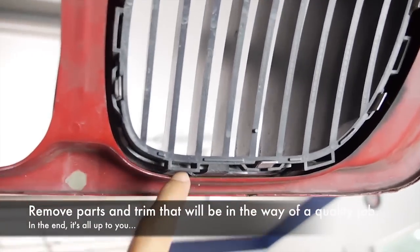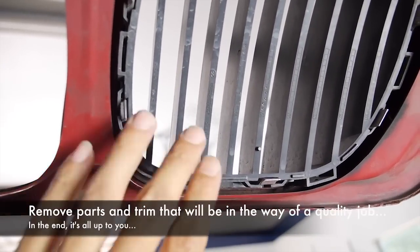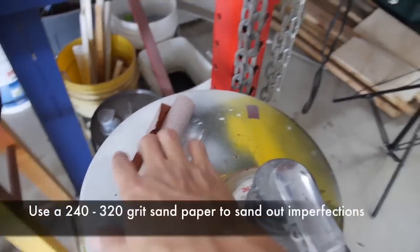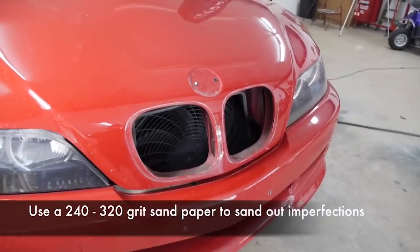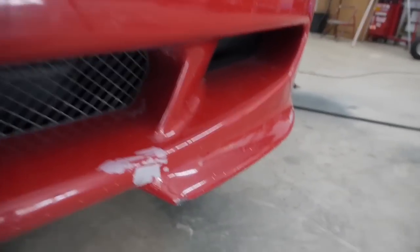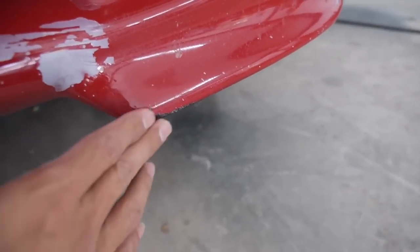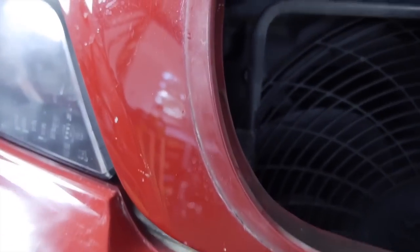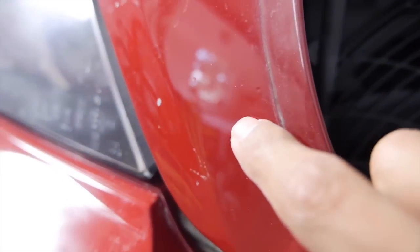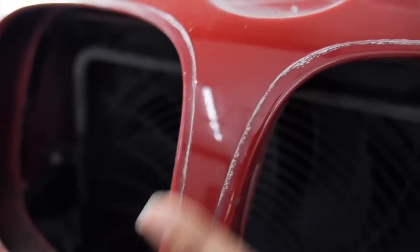All we really have to do here is get a screwdriver, go in there, and start lifting and pushing out — that's how we take the grille off. We're using 240 grit because we're going to sand out all the bad clear coat and imperfections. We're going to feather out all these chip marks, and if we look closely into the clear you can see some fish eye, so the hood was painted before. We want to get our DA and go over all of this to get it nice and flat.